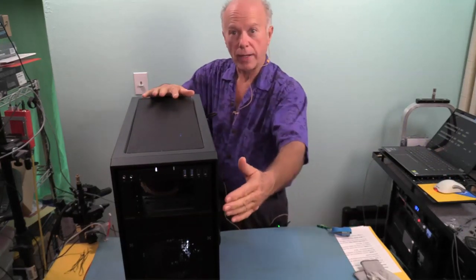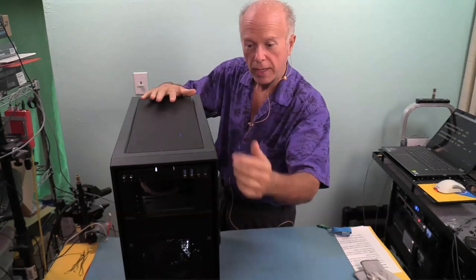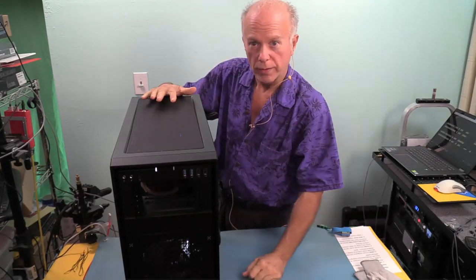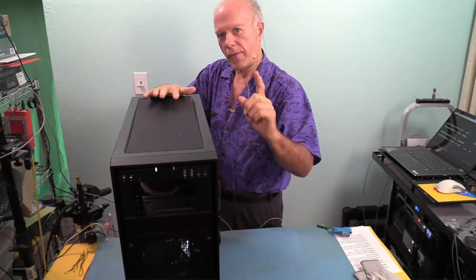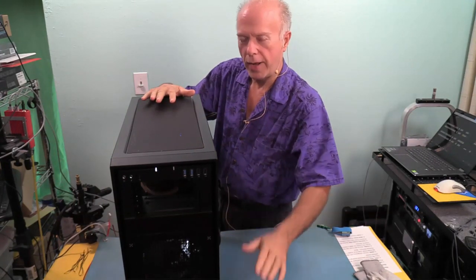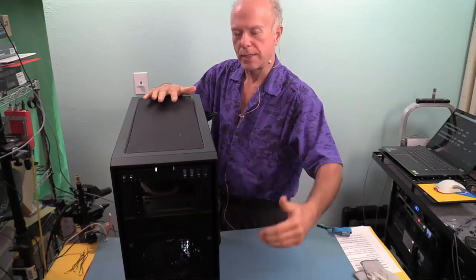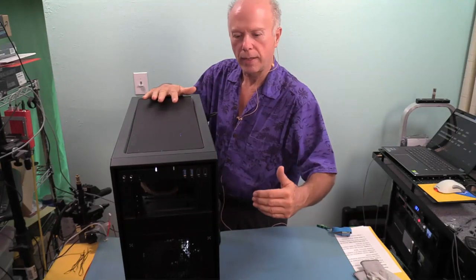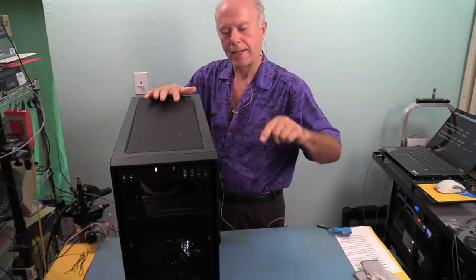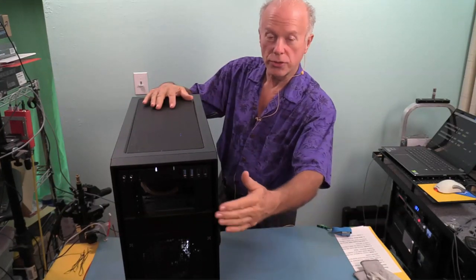Next: driver CD. By the way, we don't have a burner - we've got to put a burner in here so we can get access to the CD, otherwise we have to go online. So I'm going to shut the machine down, put a burner in connected to one of our SATA ports. We have hot swap/hot plug now on the Threadripper 3 that we don't have on Threadripper 1 and 2 - that setting wasn't there on those motherboards with the X399, but it is here. Right now we need to get a burner in this machine so we have access to our driver CD.